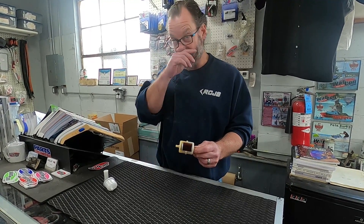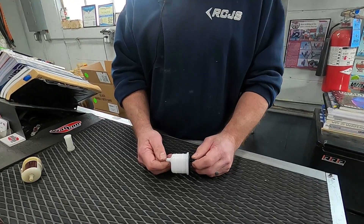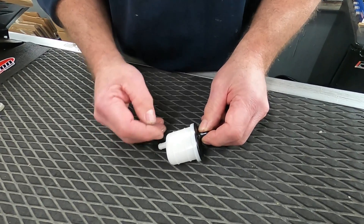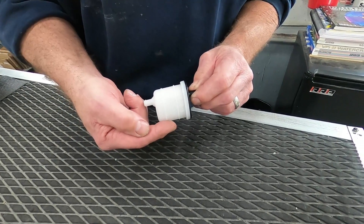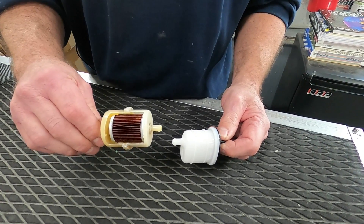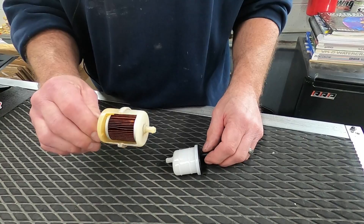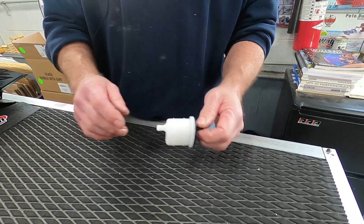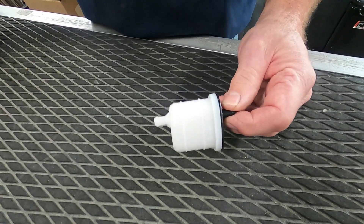What I have here is a Yamaha fuel filter — this is my go-to. We put this on everything with an inline fuel filter. This is actually a water-separating fuel filter, so it has an element in here. If you have water in your fuel, the water drops to the low point and it sucks fuel off the top. The lawnmower-type has no water separator at all — if you get water, it plugs up the paper and won't help separate it. With this one, you can actually see a line, and if you see any water in there, change your fuel filter.